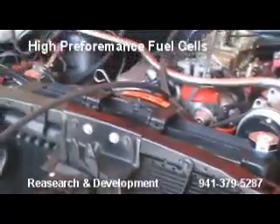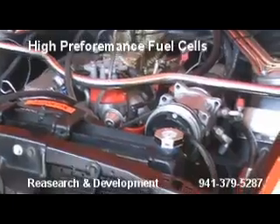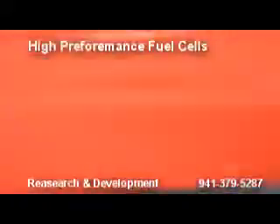What we did was, we did our timing. What did we do on the degrees? We've got base timing at 12 degrees. We adjusted the carburetor — we went a turn and a half out on our idle circuit. And here's our numbers now.